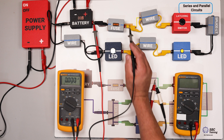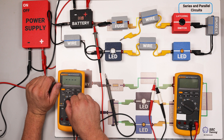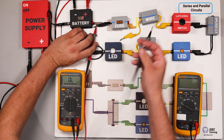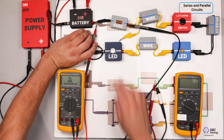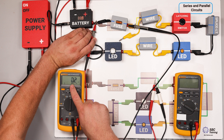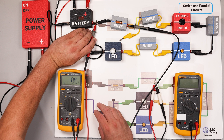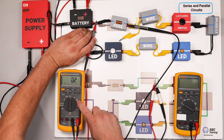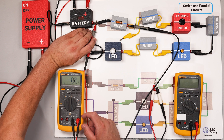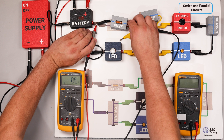I could disconnect this fuse and measure its resistance the traditional way — and a lot of people do that. Measuring from one side to the other, I get 0.2 ohms, which we could argue is a low resistance value. The problem is, inside the meter there's a battery, and when measuring resistance the meter is only outputting a small amount of voltage — let's actually measure that.